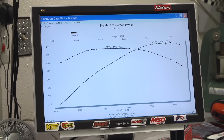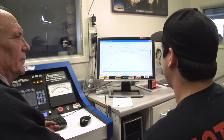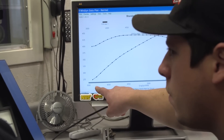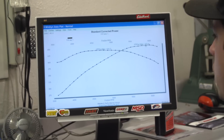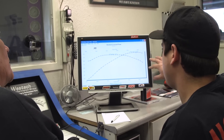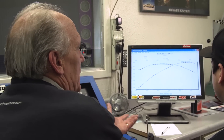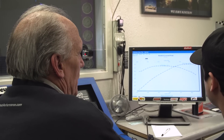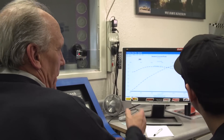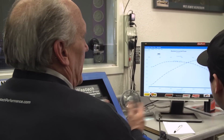This is just a really street-friendly motor. It's about 10-to-1 compression. It's got a 230/234 at 50-thou tappet lift cam in it. It's very indicative of what someone would put in a normal muscle car and drive around. The test Steve's running goes from about 3,600 RPM to 6,200 RPM, so we're not killing this thing with RPM. But we do expect that up in the higher range is where we're going to see more of a gain from the thinner ring pack. Friction loss is going to increase with engine speed. If we see gains at 6,000 RPM, you can only imagine that a racer would see a bigger gain at 9,000 RPM.